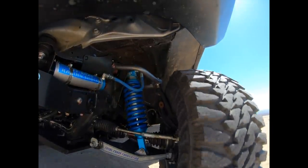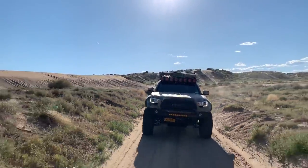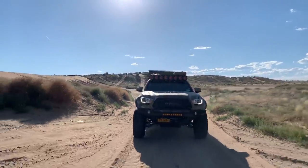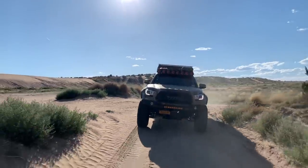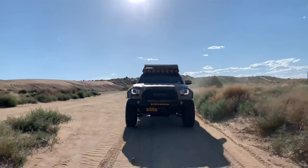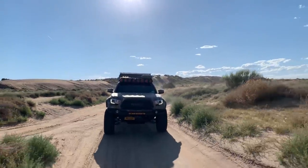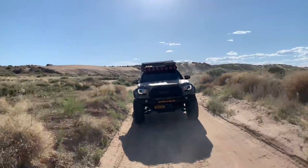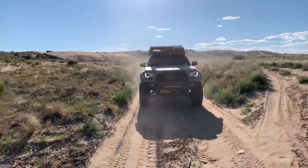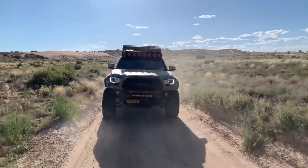This stage two usually comes with a gear ratio because we're running about a 35 inch tire. Because of its width, it's very proportionate on a 35. We can run them on a 33 with no fenders or fiberglass or anything, but with a 35, it's very, very proportionate, especially for a long wheelbase like the long bed Tacoma. The gearing in this one is a 4.88 with a front locker. It's got the ARB in the front, factory e-locker in the rear, and we're running the RCI aluminum skid plates